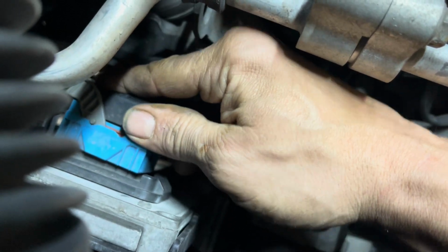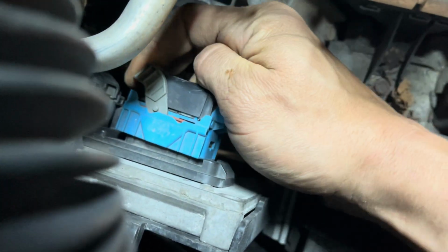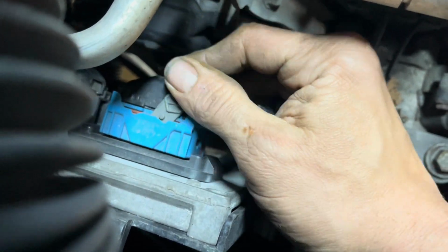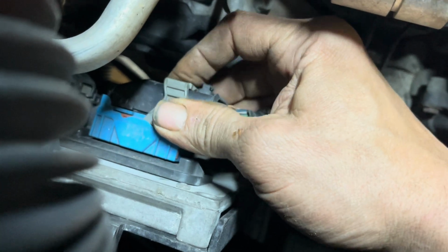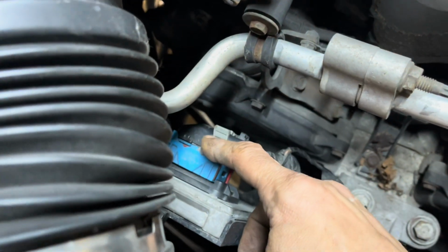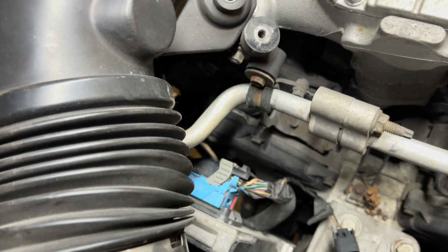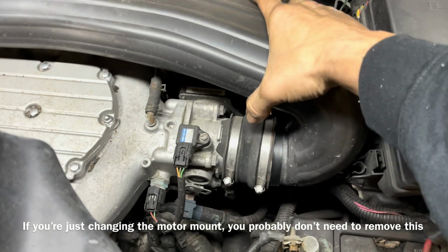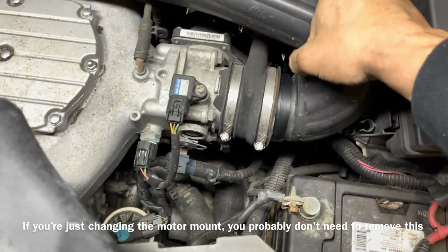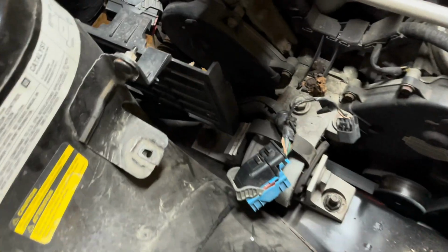And when you go to reassemble it, it should go on about quarter of the way. And as you pull this over, it should suck down. Try not to break these because it's not a good thing if you break them. Both connectors on here function and operate the same way for removal and installation. For the video, this is probably going to get in my way significantly, so I just loosen this clamp and pull it off of here.